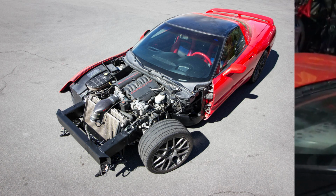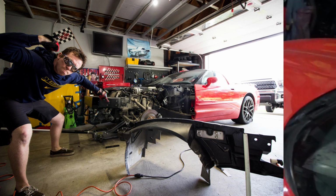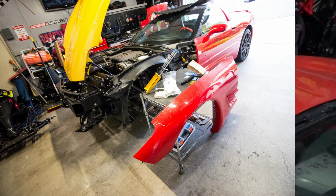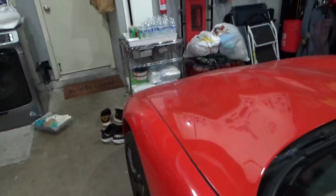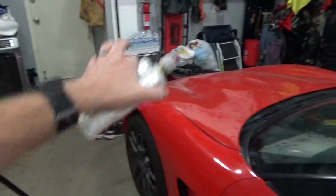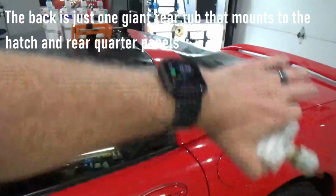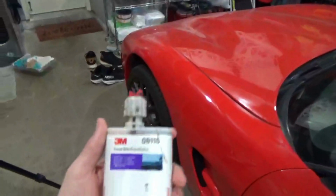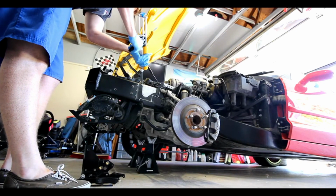my car. So I have a 2 or 3 part video series where I replaced the inner fender, which is basically like the wheel tub lining. And that's how the outer fender here actually mounts to the frame of the car. So there's an inner fender on each side of the car in the front, and then the same thing in the back. And then that pairs also with the kind of center tub area where the rear hatch mounts to. But what I used this panel bond adhesive for was rebonding that inner fender to the frame of the car.